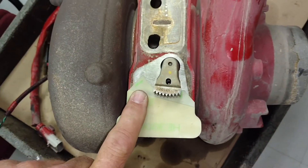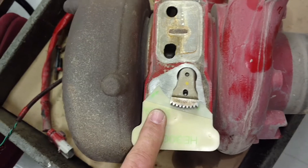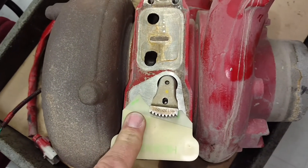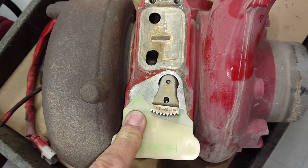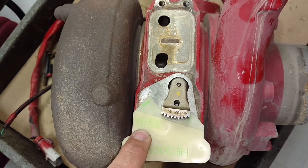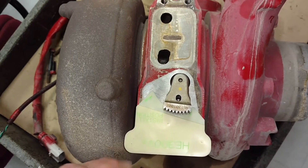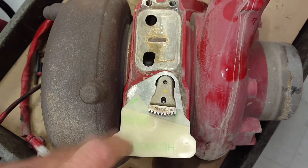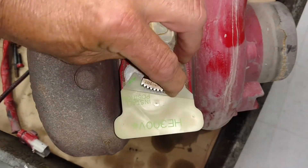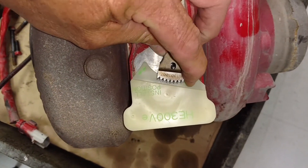This failure led to a complete exhaust system plugging up — we had to take the exhaust off and get it cleaned. It also had a turbo EGR code, and that code basically diagnosed that you need to change the EGR valve to a newer model with a stronger motor in it. Anyway, that's how you can check — you can get these guides from Cummins. That's how you test a Cummins ISB VGT turbo for binding or being stuck, and this one is definitely stuck.